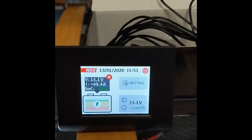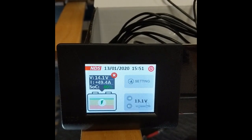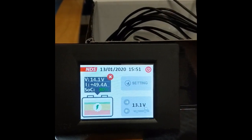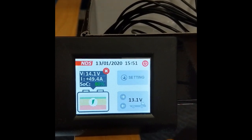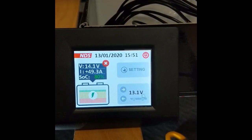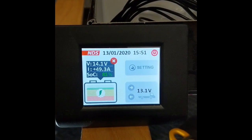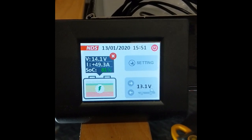Even with the fridge running, we're now charging at almost 50 amps. Without the battery-to-battery charger and without the additional cabling, we were charging at just 5 amps. So that's 10 times faster charging by installing the lithium battery correctly. Of course, having a lithium battery without this additional equipment is still a good idea, but you won't get this huge benefit of fast charging without the battery-to-battery charger and the additional cable.